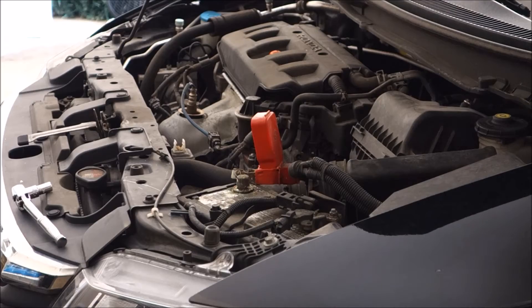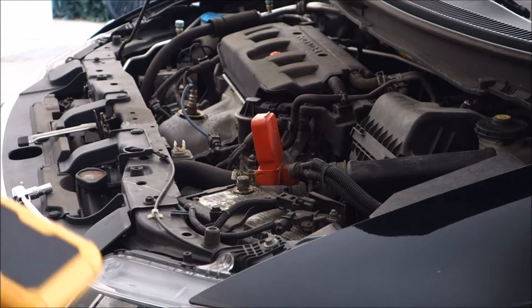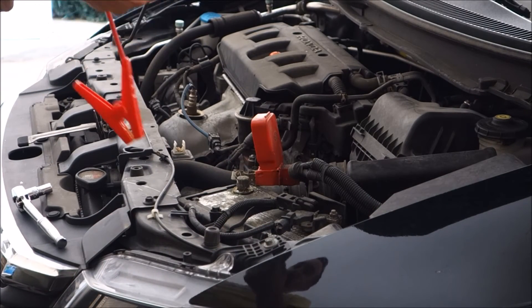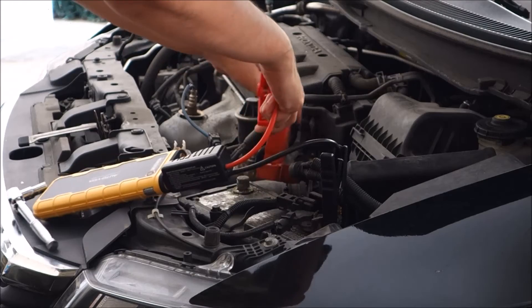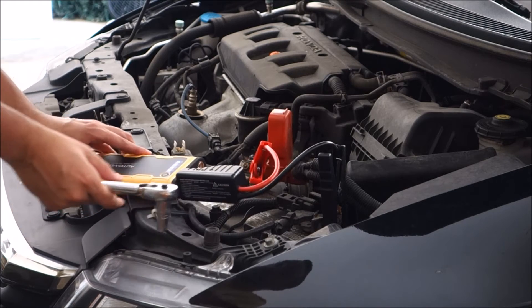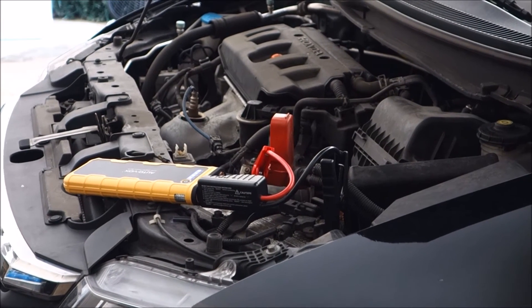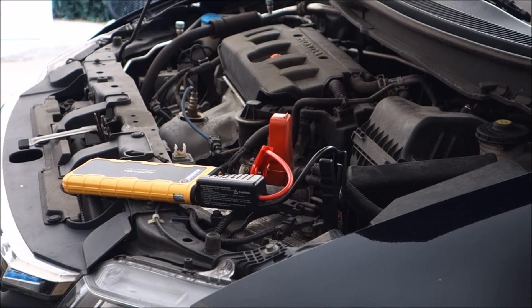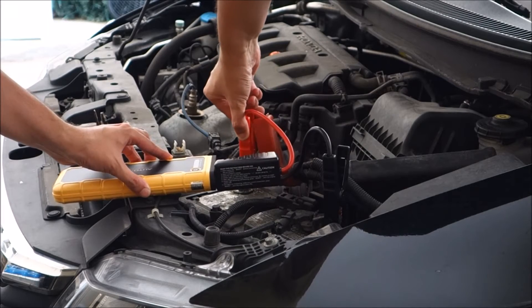Now since my car battery isn't dead, what I'm going to do here is — I already have the red cord, the live wire, already disconnected from the battery. I'll just connect the red to the red, but they're not going to be touching the battery terminal, so that way it simulates the battery being dead. This first time I did it, I didn't realize I had to push that boost button, so you'll see I get into my car and it doesn't work. The other two jump starters I used didn't require pushing any additional buttons — you just had to turn them on — so that's why I didn't think about it the first time.